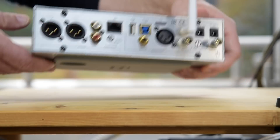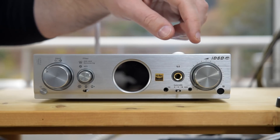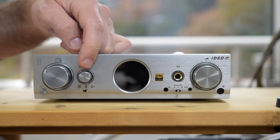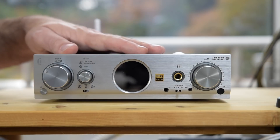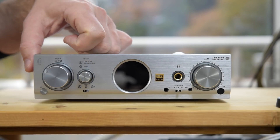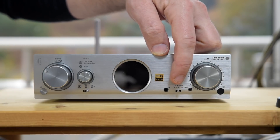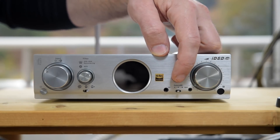On the front you have many many buttons and controls which can be rather confusing. Like the Pro iCAN, you have your volume on the right-hand side and the input on the left, and the screen indicates which input you're using. You also have a digital filter control. The big deal here is they have a variety of digital filters you can switch between, and it has an FPGA inside which will upsample and resample as necessary. You also have DSD upsampling which you can activate by pressing the button. In terms of output, like the Pro iCAN, it has three gain settings: zero, suitable for IEMs; nine, most suitable for regular headphone listening; and 18 for something like HE6s or Susvaras.